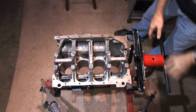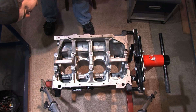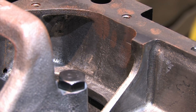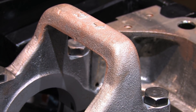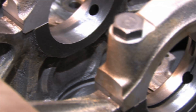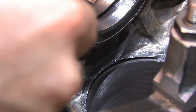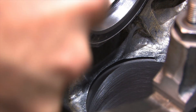This engine sat for four years — it's not good for engine parts to do this. Apparently someone touched it when mounting it on the engine stand; they left their rusty fingerprints on the block and were grabbing all over the suitcase handles too. There's a little bit of rust inside this block, but nothing that can't easily be fixed. All of the machine surfaces are in flawless condition. It just looks like crust and rust that I can easily clean right up with a wire wheel on a Dremel, which is one of the surface preparations I have to do anyway prior to application.